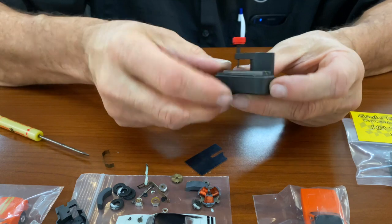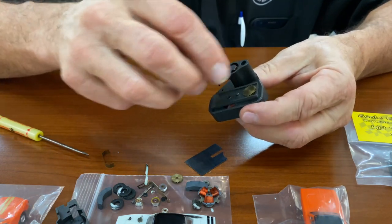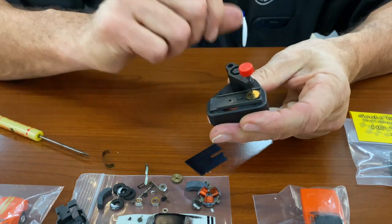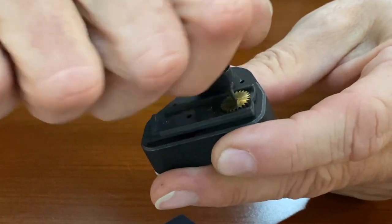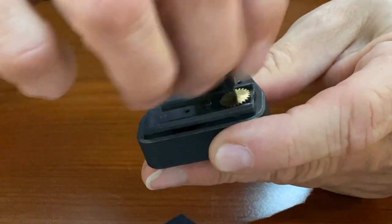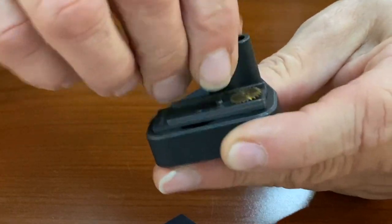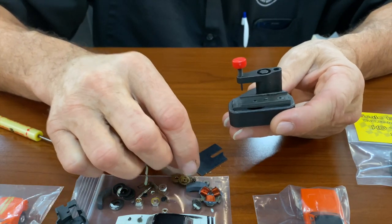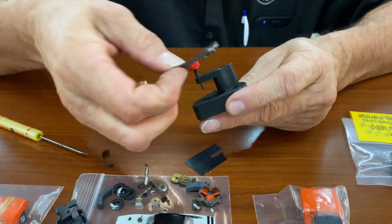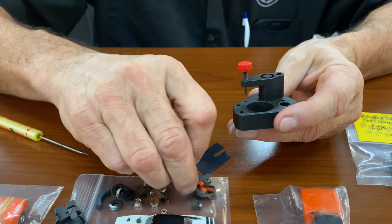So the next step is to make sure it's flat down in there, and we're going to take this gear out right here and then just swing it over. Alignment, once again, the alignment is just excellent. His work is so good on these. And see how simple that is? And it presses it straight down, which makes sure that these holes don't get elongated or expanded. So now our plate is clear and it's ready for cleaning, modifying, whatever you want to do.